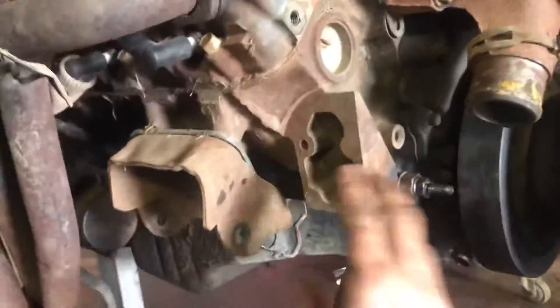To give you an idea of how I hook this thing up: I hook the ground right in front of the old mechanical fuel pump casting — that's your ground — and then I put my live from the battery right there to the starter, and then I just cross those two prongs to kick the drive out as well.